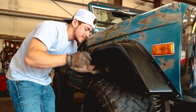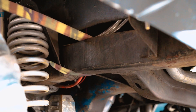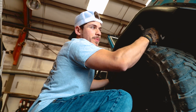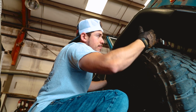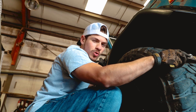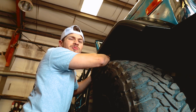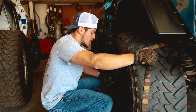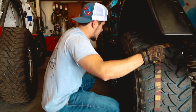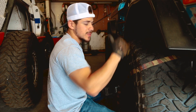What we're going to do is put the ratchet strap around the frame and then pull the body and the frame this way until we get the same measurement on both sides. It just makes it a whole lot easier. I've only done this once, but it worked back then. Once you've got your ratchet strap attached, all you want to do is ratchet so you're pulling the body and the frame this way.